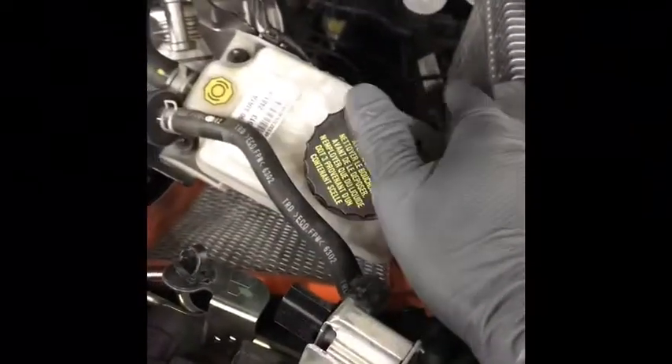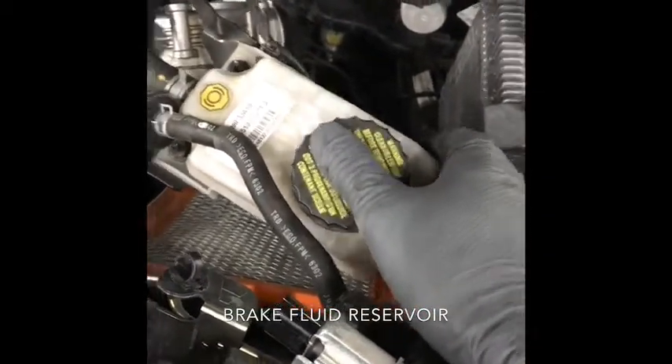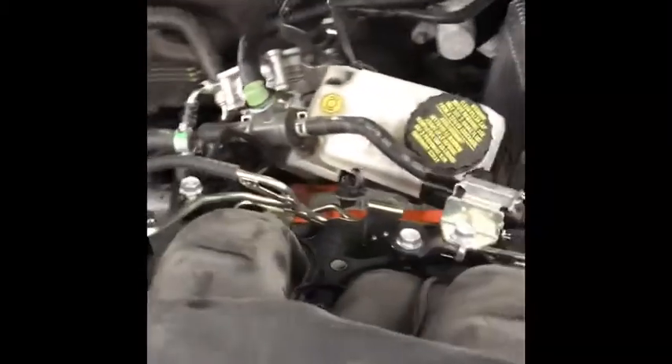In addition to that, in order to get around the other side, I had to remove the brake fluid reservoir and the bracket that holds that on — it's just a couple of screws. So in order to reach my hand in all the way, I also had to take the top off the air cleaner. So I had to disconnect the air cleaner and take that off.